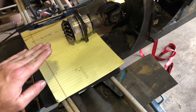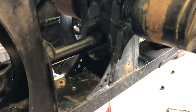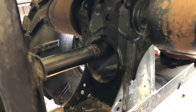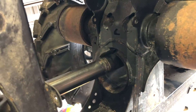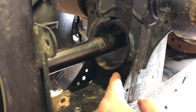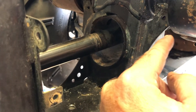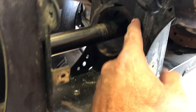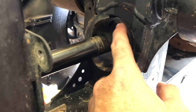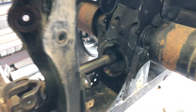Also, cutting this frame and making the cradle is important, because I have to drop the motor down low enough to be in line with our output shaft. The reason why is that you have this torsion bar that goes across, and if I go up any higher I don't have a whole lot of play. I'm going to have to cut this out as well — maybe take a piece of square tubing, which would be ideal to get more square footage in here. I have to make something here and notch this frame out, because we need to move all this over.